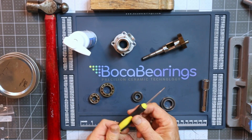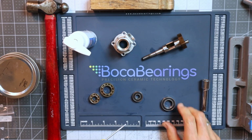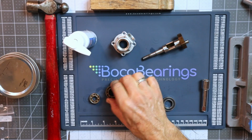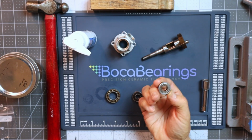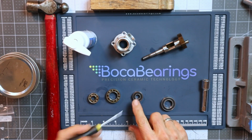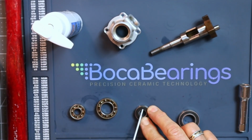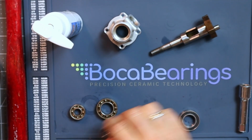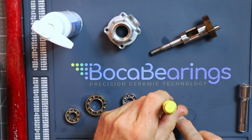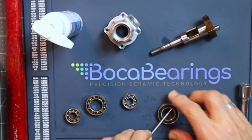So I'm going to grab a small flat blade screwdriver, and as you can see, this rear bearing is open on both sides. It has no shields or seals on either side. The front bearing is metal shielded with the rear of the bearing open. So I'm going to leave one of these rubber seals on here and just remove one side so that it is the same as what came out of the engine. On this one I'm going to remove both. So I just go in here right near the inner race and gently lift up on this.